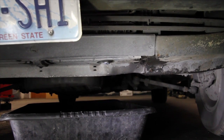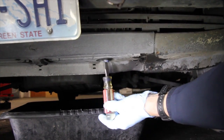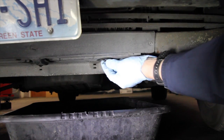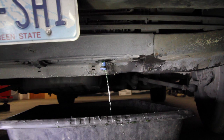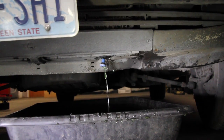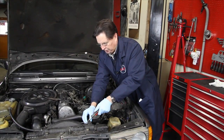Almost all Mercedes with plastic tank radiators have a drain plug under the car that allows you to drain the coolant. On this car, it's located on the left side. I'm going to go ahead and get a drip pan handy, loosen up this plastic plug, and let the coolant drain. It's coming out pretty slowly; I can loosen up the coolant reservoir tank to speed draining. Now I can loosen up this upper clamp and let you take a close look at this plastic radiator neck, just loosening the clamp enough to pull the hose straight back.